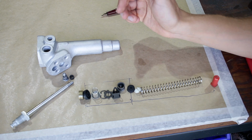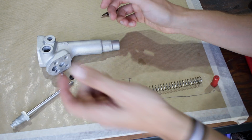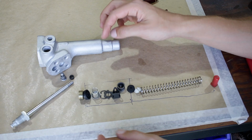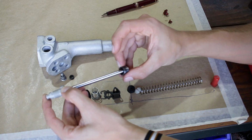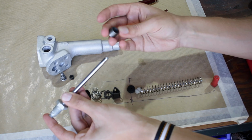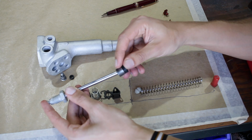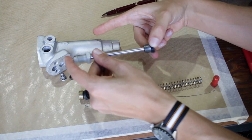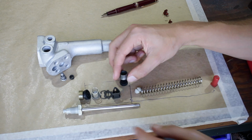But when you have the whole vacuum side connected, when you put your foot on the brake, you're going to actuate this little piston which opens the air valve and gives you your vacuum boost. And then it pushes this rod along until it comes into contact with this piston, and it seals, because of course, that's the tapered edge. You get a tapered seal in here. And then this will push this seal towards the end of the cylinder, thus amplifying your brake pressure. And it's really that simple.